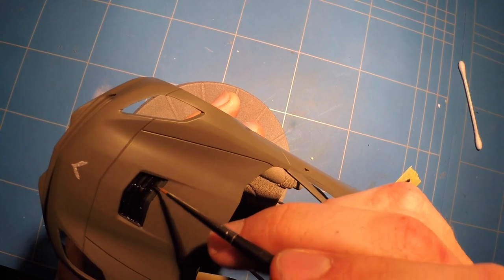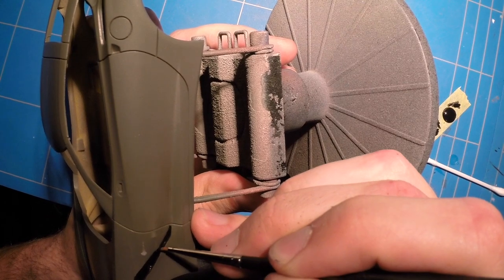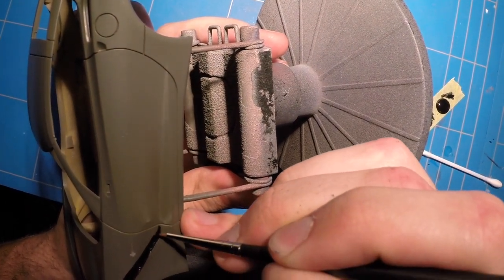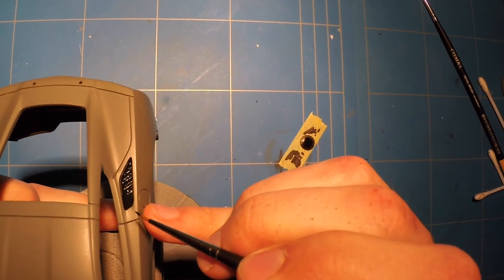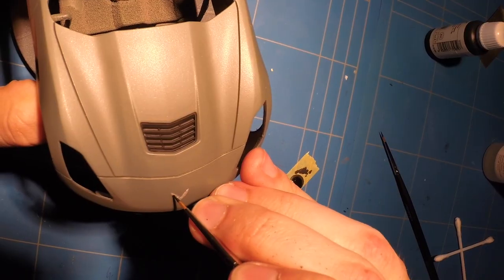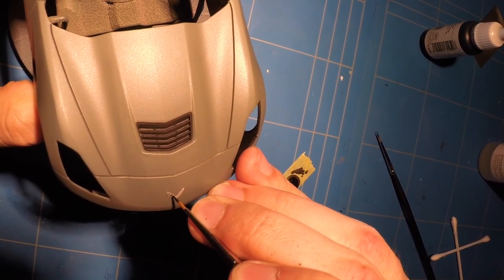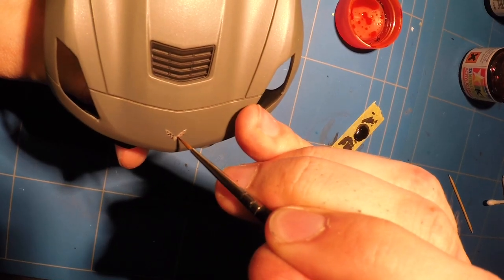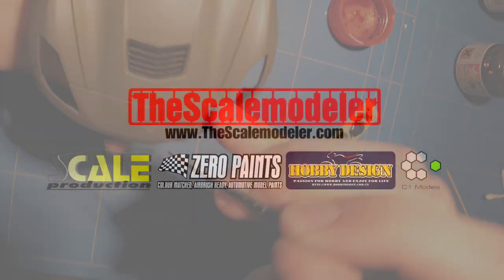The brush strokes left here are not really visible after clear coating, so that's another thing you don't need to worry about as long as you're tidy and satisfied with the results — it's all fun and games. This obviously only works if you're applying acrylic onto another paint type and removing it with acrylic thinners. If the paint on the body is also acrylic, it doesn't really work when removing it, but if you just keep it tidy and don't make any mistakes, you should be fine and the clear coat won't affect it either.